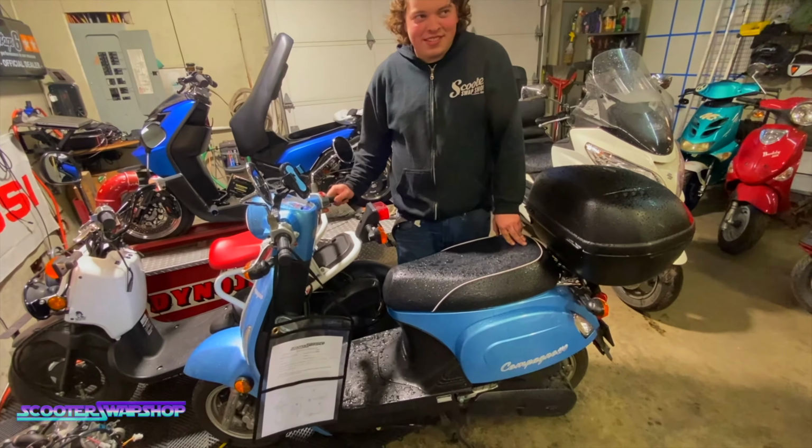It just has zero power. It's barely even rideable below like 9,000. And this is what I experienced on the other cylinders, I'm sure you guys saw. I'm experimenting with jetting right now. Maybe not. Choke. It seems like it wants a pretty small pilot, which is kind of odd.